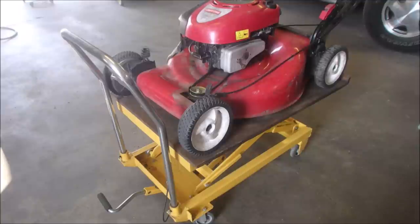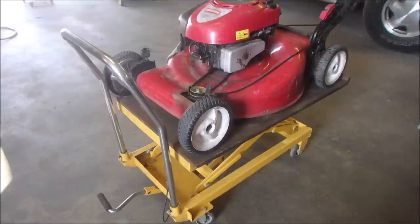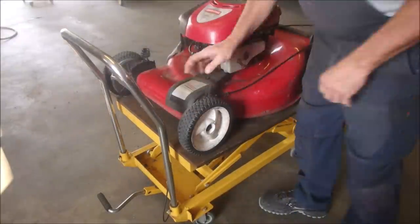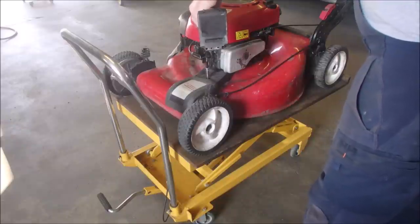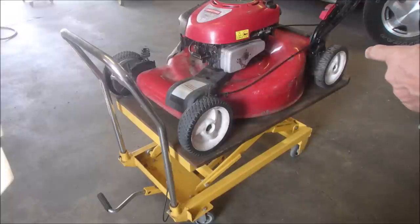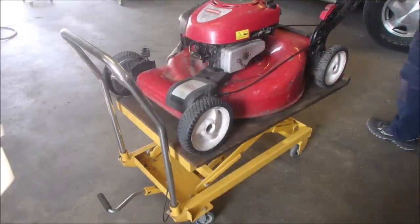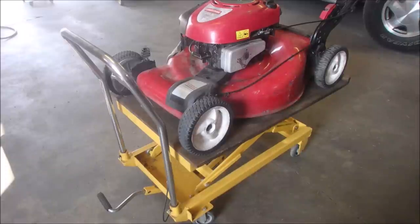But anyway, I cleaned out the dirt off the outboard from underneath. Got the broccoli off. Belt looks good. I tell you, these lawnmower belts blow me away. They either work or they don't. So now all we need is an oil change. Clean plug, sharpened blade, new treads on the front tires. I did that. And let's just start her up and see how she runs. I did have it tilted for about an hour. And if it starts up and runs fine, we will change the oil.